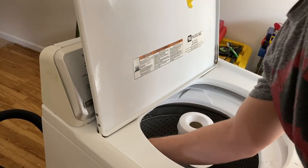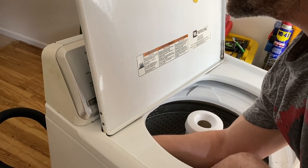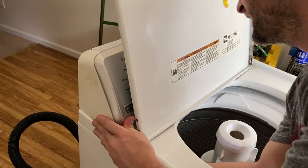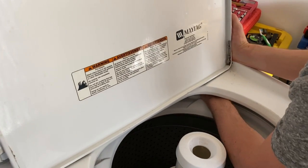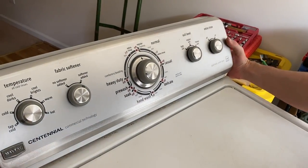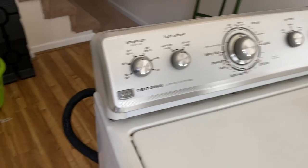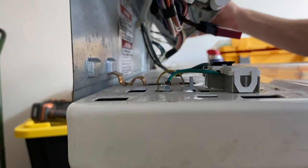This is not easy for people with large hands. If you want to push this forward to give yourself a little more room, you can do that. Once you find it, push it forward and then lift up a little bit — and that pops up on that side. Move this over and do the same thing on the other side: push it forward and lift up. Now you can see both sides; come straight up and pivot at the back. There are little hooks underneath that keep this in place, so make sure you don't come straight up — come forward a little bit and up.